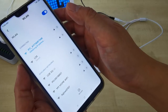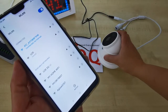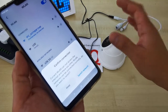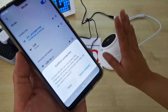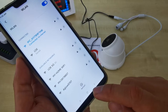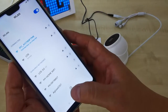Double check whether the password you keyed in is correct — 12345678. Then click connect and wait for obtaining IP address. Once connected, new Android phones will prompt you that the Wi-Fi hotspot does not have any internet data. This CCTV does not provide internet data, so make sure you keep the current connection. Now your phone is connected to this CCTV Wi-Fi hotspot.